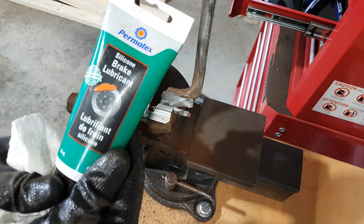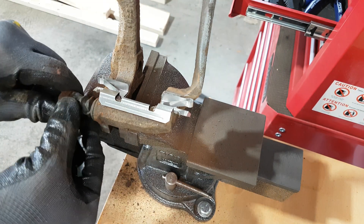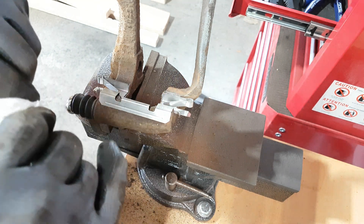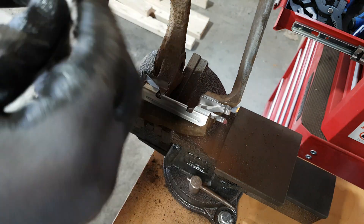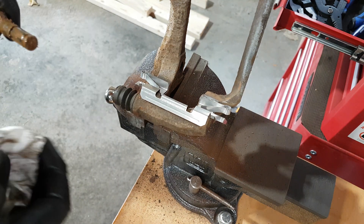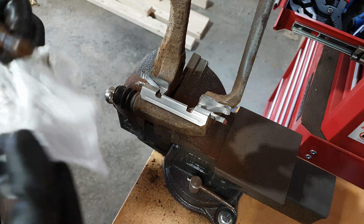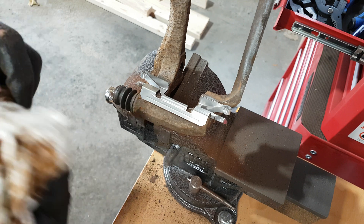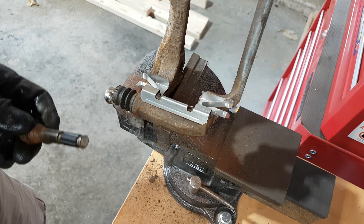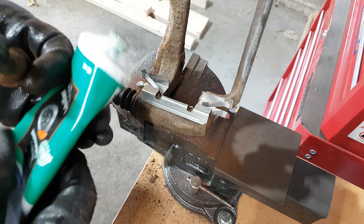You can put a little bit of silicone brake lubricant in the stainless steel clip if you want the brake pads to slide easily. You'll also use it to lubricate the slide pins. There are a couple of rubber dust boots, and on one of the two slide pins there's a rubber piece that if you use regular grease instead of silicone, it's going to degrade the rubber over time. You need the rubber boot to repel water. I don't recommend using anti-seize because it contains some grit and it's not designed to be a lubricant. Make sure you wipe all the old grease from the bracket by putting the old pin in and wiping it repeatedly until the towel is clean, then replace the brake grease before reinstalling the slide pin permanently.